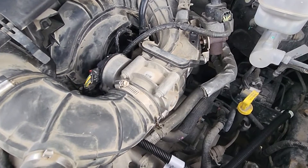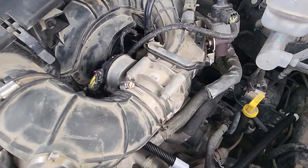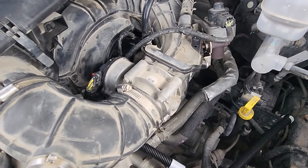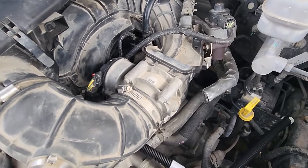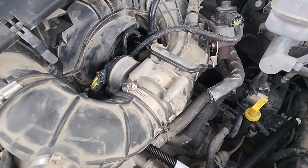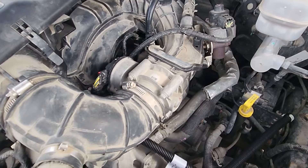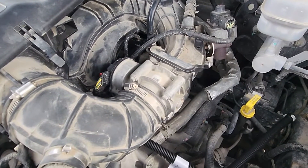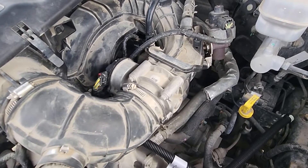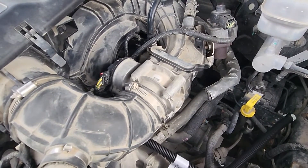On the 4-cylinder you'll want to remove the battery to get better access to it. On the V6 it's actually quite easier. Once you replace the throttle body, the important thing is to do the recalibration, which luckily you can do by yourself. You don't have to take it to a dealer and you don't need any expensive diagnostic tools. Once I replace this one I will show you what has to be done — you pretty much just have to start the vehicle with all accessories turned off and leave it idle for a while.